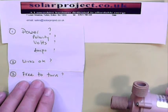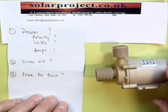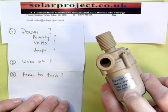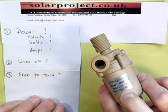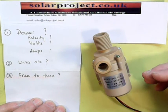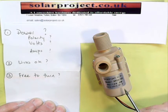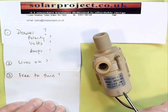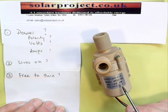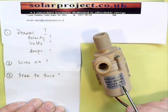I've got a little checklist here of items to think about and the order in which to consider them. The 12-volt pump — whether it's the 6-watt, 8-watt, or 14-watt model — needs between 9 and 14 volts to run, and the power supply needs to be rated at sufficient amps to match what the pump needs. The 6-watt pump needs about half an amp, the 8-watt model about two-thirds of an amp, and the 14-watt pump runs best on something over an amp.